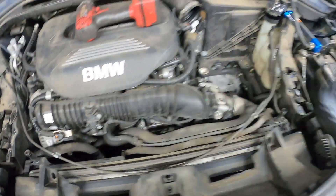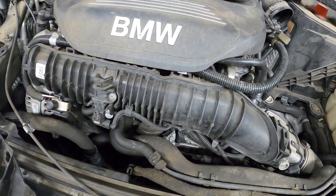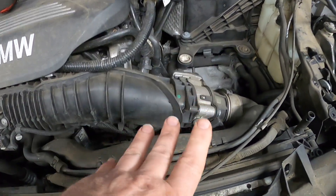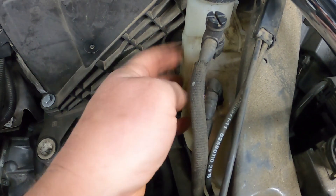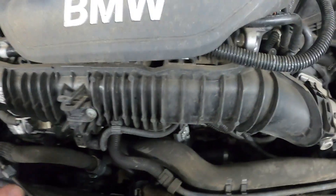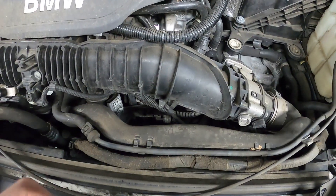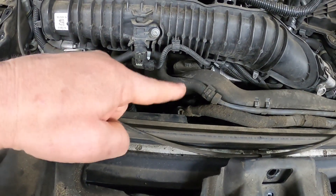Let's cut this off and get this out of here. This is the hood release cable — you have to pop the clips off of the upper support. Now we need to get some of these hoses out of here. Be really careful because you have these plastic hoses that run over to the radiator fill bottle. We're going to be very careful taking anything out that we're going to have to reuse. I'll get this plastic hose out and then we need to get the fans out.